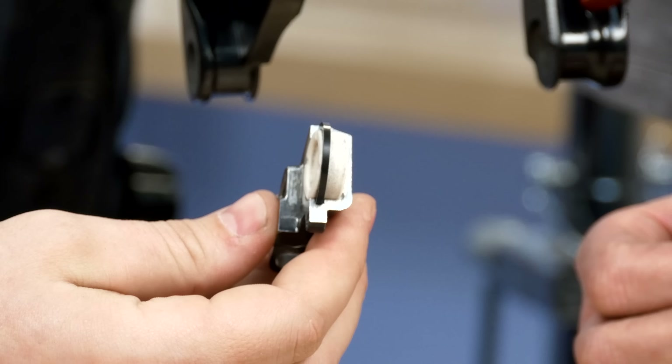All of this braking and riding has gotten lots of crud on it. Eventually we're going to put some new pads on this bike. First step: take out the old pads. We want to push the pistons back home through our seals — but that's the dangerous part. This is all dirty, and we don't want to push it all back. Don't feed your seals junk. Let's clean it up and show them what to do.